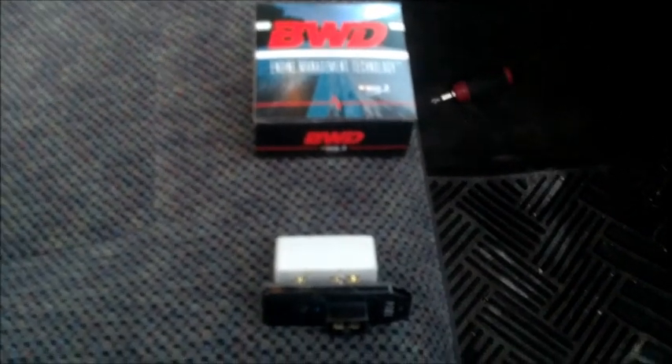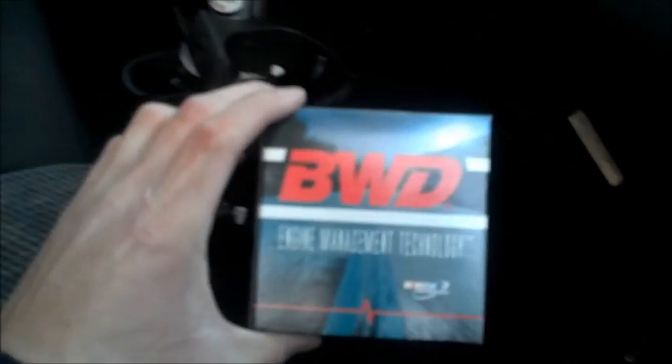I'm getting ready to put the new resistor in. Here's what I got from Advanced Auto — it was about 60 bucks, not too bad. You can see the new one's in a lot better shape. It's got a little notch on one side of the plug — it mounts with the resistor part facing up into the underside of the dash, and the little notch on the side faces toward the driver side. I had to use a little stubby screwdriver to get it out because it's sort of tucked up under there where the floorboard rises up and there's just not a lot of clearance. So anyway, I'm gonna go ahead and get it put in and see if that solves my problem.